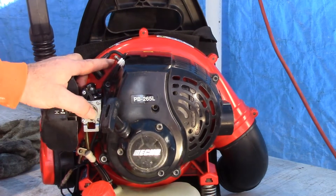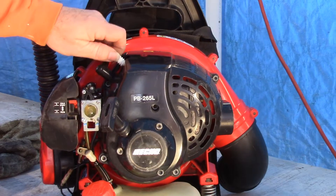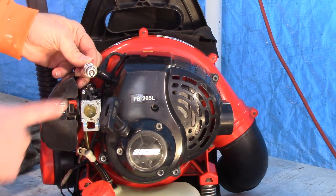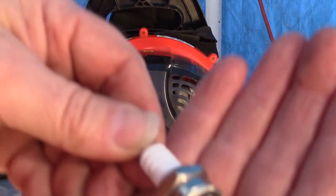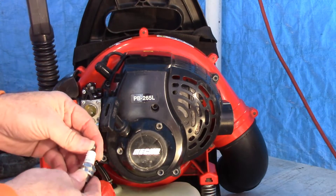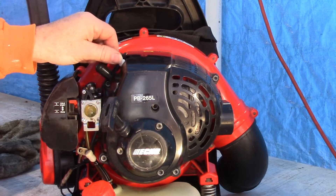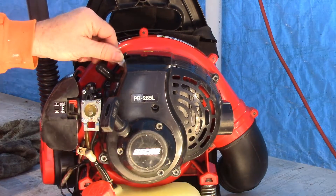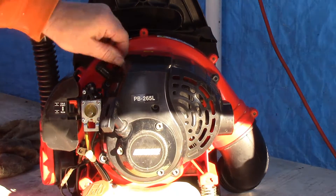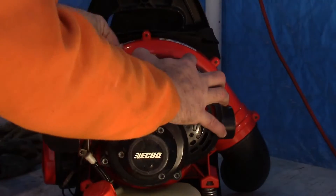It's purging, which is good. I also see this spark plug — you buy those carburetor kits and they come with some very inexpensive plugs. This plug has never been fired; it's as clean and unused as can be. I don't have a lot of confidence in these cheap spark plugs. And it wasn't even tightened in there — just kind of hand tight. But now you know what I know, and we're going to see if it'll fire up.